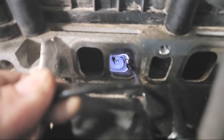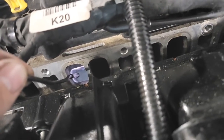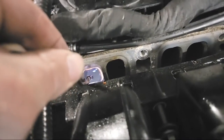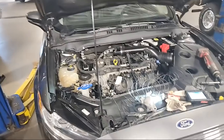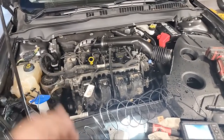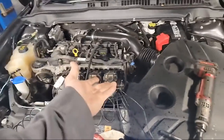You can see how nasty that valve is, and in the cylinders I had closed — this motor's junk, so that's why I'm showing you on this one. You can see all the CRC fluid I've filled in there — it's working and cleaning, and you can see it starting to get dark, cleaning the deposits off those valves. But again, it's not a very harsh or instant chemical. It'd be better to use the Valvoline industrial stuff they give shops for professional use — dump that down in there and come back 30 to 45 minutes later and it'll almost dissolve that stuff right off. The stuff at the dealership is a completely different, way more harsh chemical makeup than anything you can get off the shelf.